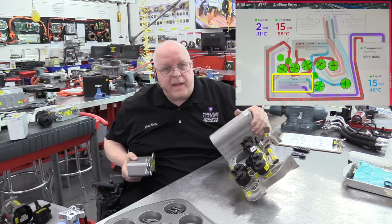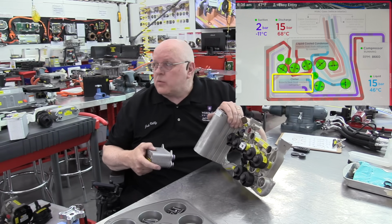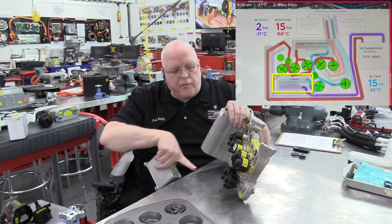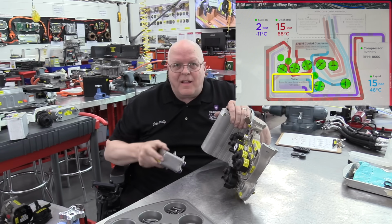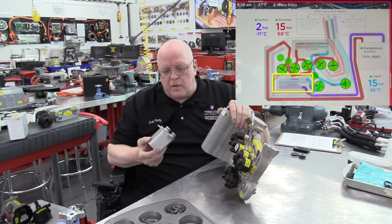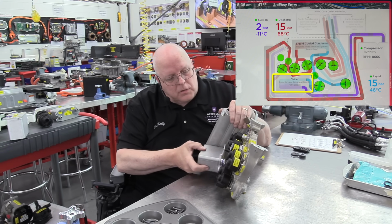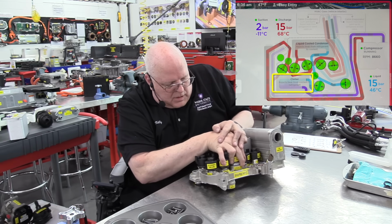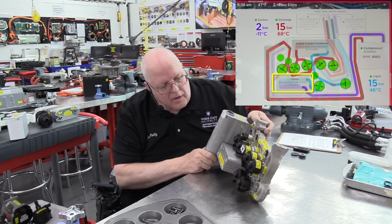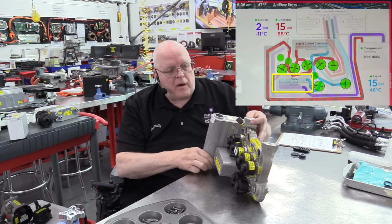Okay, I'm going to bring in the chiller now. It just plugs in to these 2 holes right here. And we have the chiller inlet at the top from the chiller electronic expansion valve, and the outlet at the bottom that goes over to the receiver dryer. It just has a couple of O-rings and some bolts that hold it in place. AC lube oil on those O-rings. There we go. Goes right in. There is our chiller installed as part of our supermanifold.